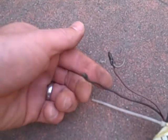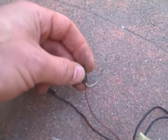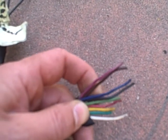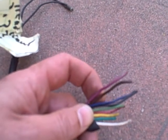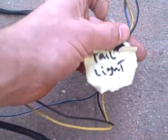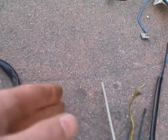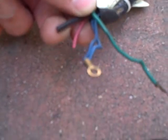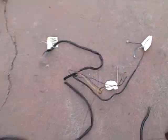Let's go over the whole thing one more time. Starting at the top for the wire loom — headlight: two browns, a dark brown and a light brown; the light brown has a gray coming out for the high beam; two blacks connected to one connector. Switch on the handlebars: white, dark green, yellow, pink, light green, black, blue, brown, purple. Coming down to the horn: green and white. Over to the tail light: black, yellow, blue. Up to the HT coil: green, a double blue connected, a pink, and the black. And finally over to the brake: black and blue. There you have the entire thing.